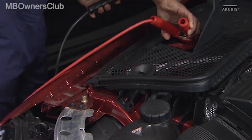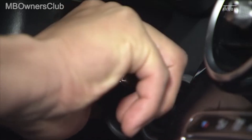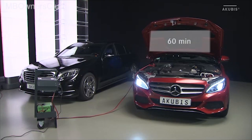If there are no leaks, defrost the lamp. To do this, connect a battery charger and start the engine. Turn on the low beam and wait an hour for the headlamp to clear. Do not use external devices to clear the headlamp.